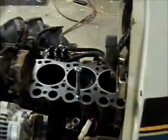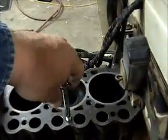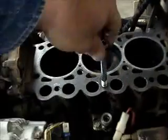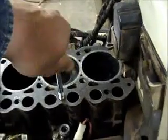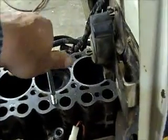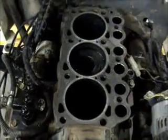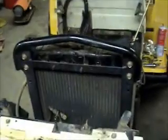Those inner eight bolts are what actually torque the head down — these outer ones are just side bolts. They only get about 25 to 35 foot-pounds of torque, and it's only like 50 to 60 foot-pounds on the center bolt, so not very much. I thought that was weird for being a little diesel motor, but this is considered a high compression diesel because the motor just has a dish in the piston. From what I understand that's not actually a very high compression motor, but I don't know.